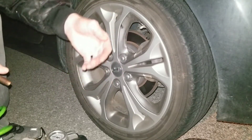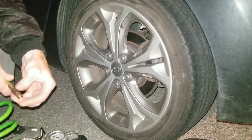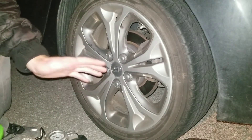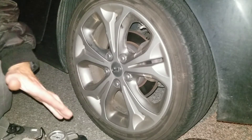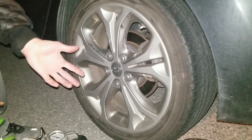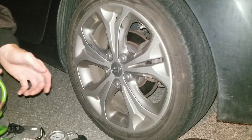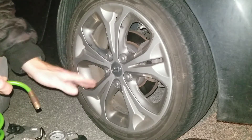If you have a Mercedes where the front tires differ from the rear tires — where tires need to be less pressure in the front than the rear because they are different tires — in those cases you're going to stay with the stock tires regardless. So you'll go by the manufacturer's recommendations. I always recommend that, but if you change to performance tires or some other tire, you want to go by the tire manufacturer, because different tire means different tire pressure. The car's giving you what you need as far as the original equipment tires are concerned.